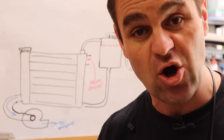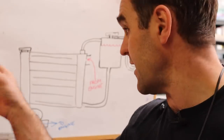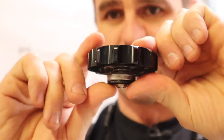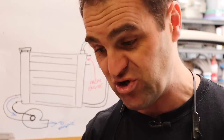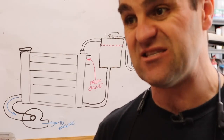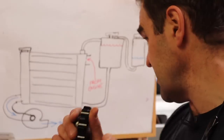But then you have the issue that when the radiator gets hot and produces steam, there's expansion. In the past, you'd have a radiator cap sitting on the radiator, and as the water gets hot, the steam would press up on the radiator cap and then leak out a hose on the side that would just go onto the ground. All of that steam and overflow water would just get dumped onto the ground. That is not the way it's done these days - they want to keep everything inside the car. And that is where this modern system works.